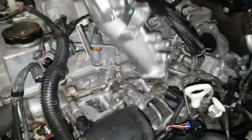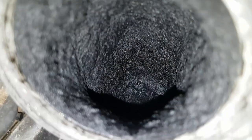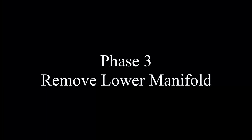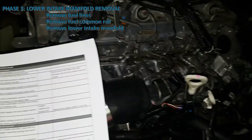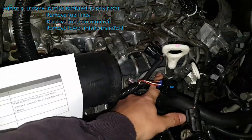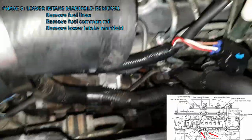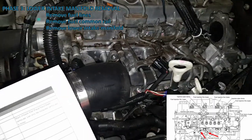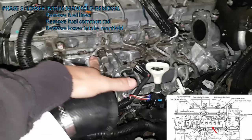I've already cheated and cleaned this bit — it's not too bad. But what I haven't done yet is that nasty piece of work there. We're now onto the lower manifold. The plan of attack here is: I'm going to remove this dipstick completely, check that there's no dirt around these fuel pipes, remove some of those pipes, undo some P-clips that are buried in there, and take the common rail off — which is this thing here. After that we should be right to start removing the lower manifold.